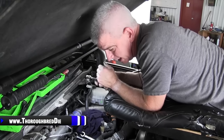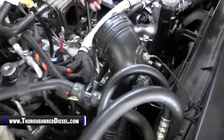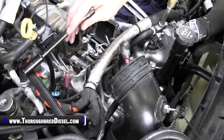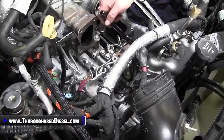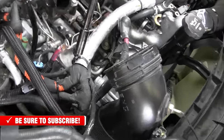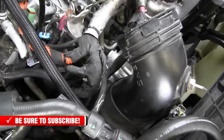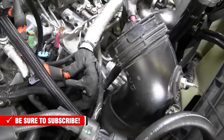All right, there'll be a couple of camera shifts here, but what we're working on now is the fuel feed line that feeds the fuel filter housing, which we will replace with the one coming with the Fleece kit. So it goes right over here. We want to remove this bracket right here because there's a 13 metric bolt underneath it. You can get to it with a wrench. It doesn't need to be taken off necessarily, but we're going to go ahead and pop it off